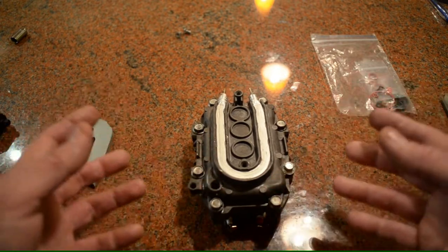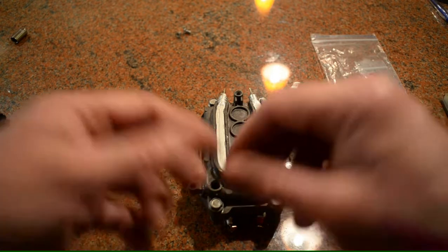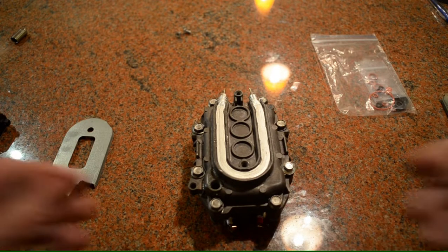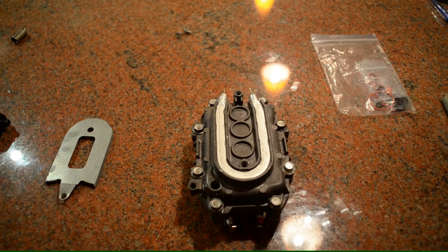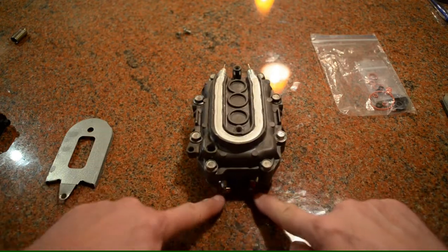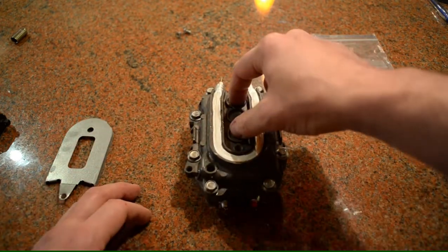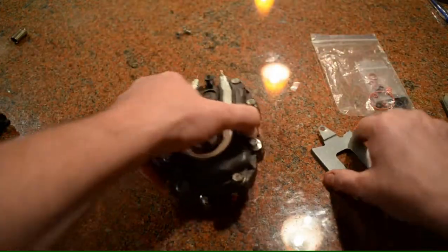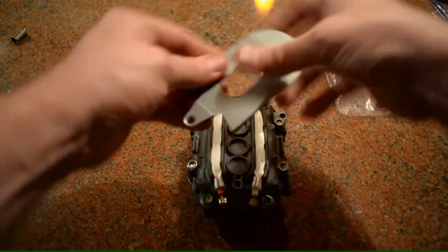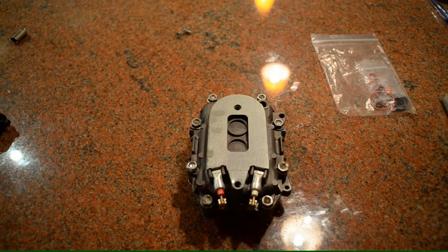If you're doing any kind of seals, I highly recommend using food-grade grease — just a little coating — to keep it from drying out and to create a stronger seal. This is the front of the machine because these two points here are pointing up. This actually gets mounted onto the backboard of the machine, and this is where our two sensors are going to be going. I'll put this piece on the back right now, and then we'll get this back onto the Solus 5000.